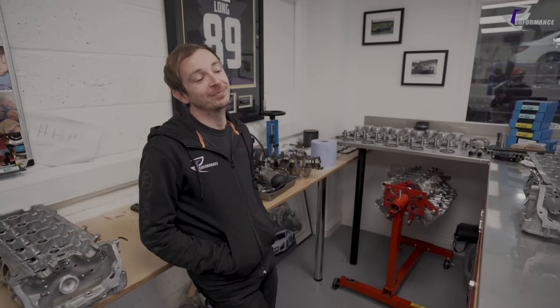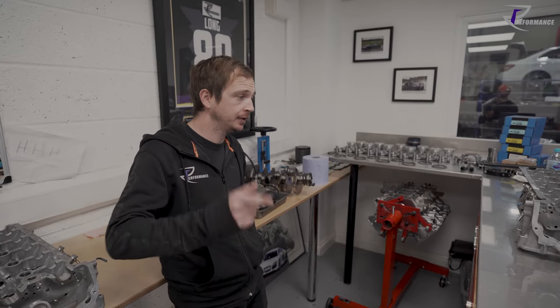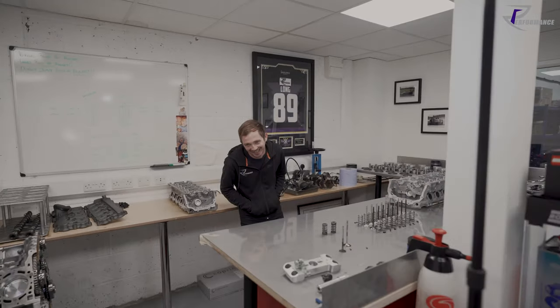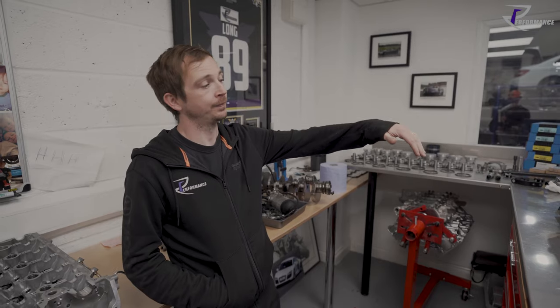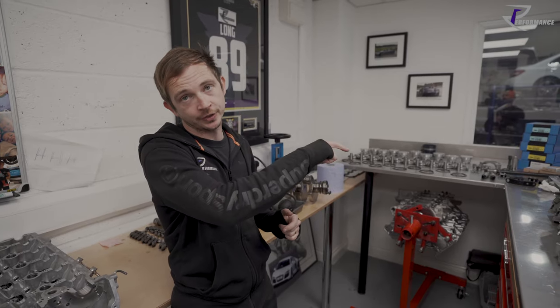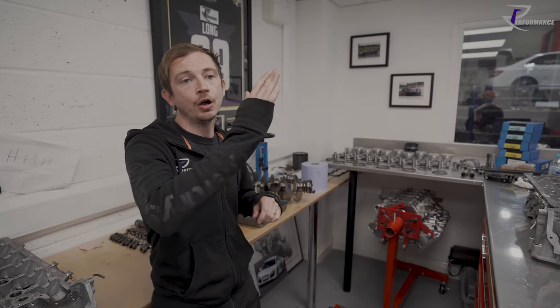Right, sorry. We took a pair of variators, and then we degreed the crank. For every degree of crank rotation, we had cam lift on exhaust and inlet. Never work with, what is it they say, kids and animals. Then we started to move our cam timing adjusters. We machined them so we could put screws in and adjust them by 1 degree of cam timing movement.